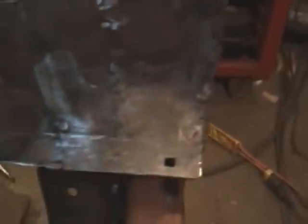I've got the welds all ground down nice. It's going to take a little skim coat of filler to cover that, but I needed a skim coat of filler to smooth out the irregularities in the rest of it anyway. Same thing over here - not too terrible, just a little skim of filler to fill it up. I guess that's the end of the patch video.